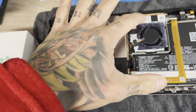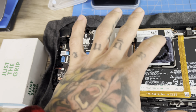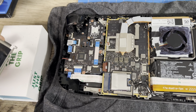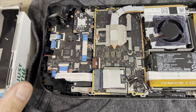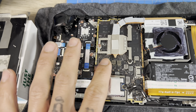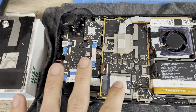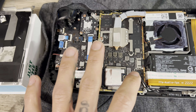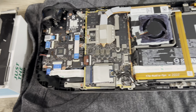We already have an active cooler here, so we can easily tap into it. We know this thing is running way cooler because of the fan mod. We need to get as much heat from here to the heat pipe, and we're going to do that with our copper plate. The question is how big we want it — we need to cover the heat pipe and the APU and the VRMs. I'm not sure if I want to bring it all the way down to the SSD and controller.